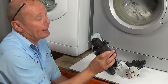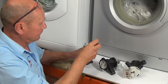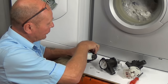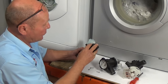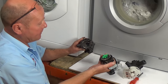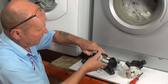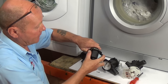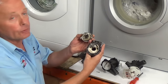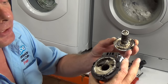You also have one which has two, three, or sometimes four screws in the back — you just need to remove these. It's also a good idea to use a marker to mark where the pump motor housing comes off before removing it, so you know the motor is lining up correctly. It just pulls off and you're able to remove any debris from within. On some models the pump part may separate from the motor and you can remove the armature and see all the gunk built up inside.